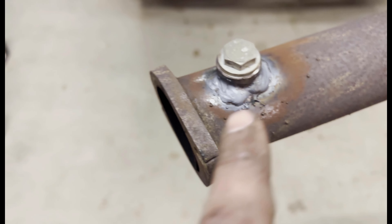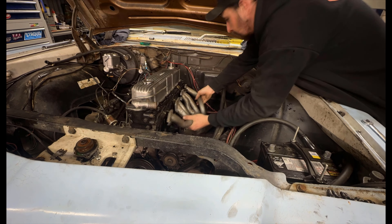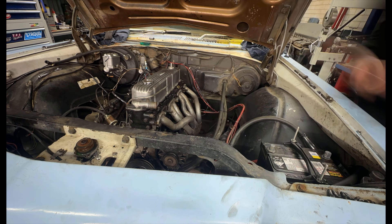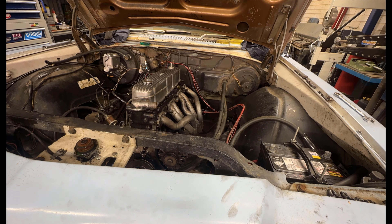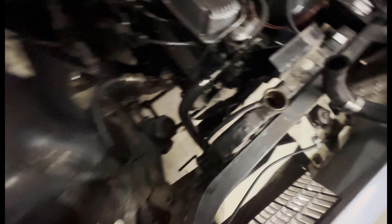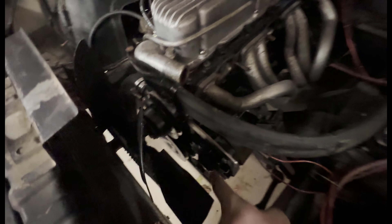The big glob has been re-globbed and now sealed. Fan and rad are back in. I'm running the belt setup for the alternator and the water pump. I'm actually going to go get a new belt — this one is 11A 890 and it's missing two teeth. But I actually worked out I need a slightly longer belt anyway.